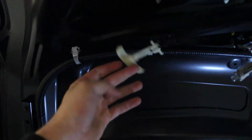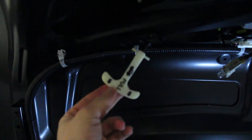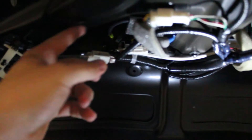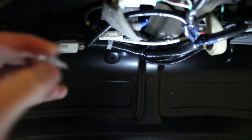I'll go ahead and pull all those out off-camera and then put the bulbs in. I got the trunk liner down. The only thing you need to work around is right here where the manual safety pull is for your trunk — just pull it down like this and hold it back and it'll slide through. The light bulbs are right up in here just like that and you just twist them and they'll come right out. We're going to go ahead and switch the bulbs — just grab and pull the bulb out.